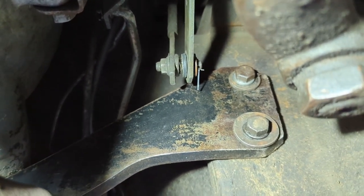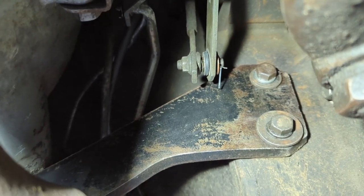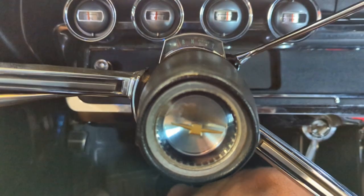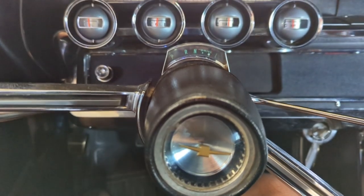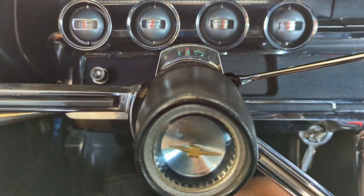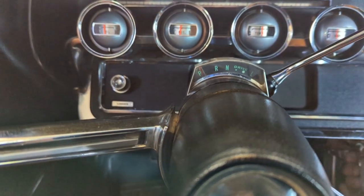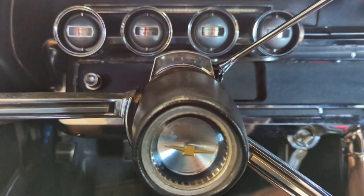We have trouble with the car starting. The manual does say to go in and adjust the neutral safety switch, which on this car is on the column, not on the transmission — but we'll worry about that once we're done. All adjusted — let's see how she works: right into reverse, neutral, down into drive, right into park. She'll start — no reason to adjust anything now. Good.